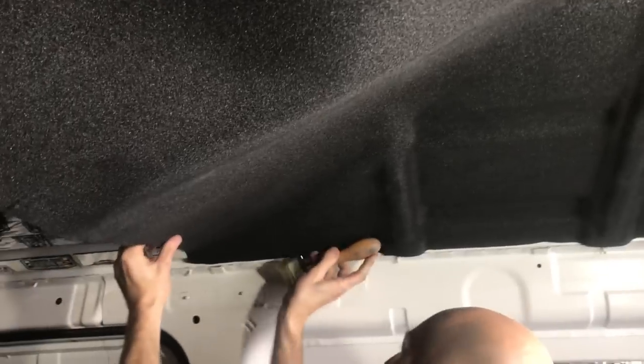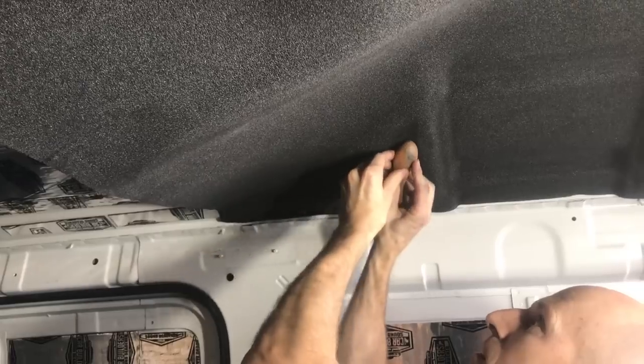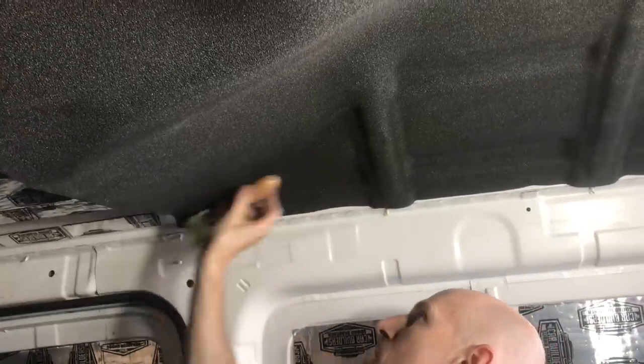So I'm going to push it in there first. And then that allows us to chase it down here. So you use both ends of this roller, especially where these negative shapes are. And you can see our plastic's sitting about there at the moment. Which makes it manageable. So it's probably running up here. So I'll start following this one up too. And you can see there it's pushing into that high. So our plastic's running, I can see the line there. So I'm gonna go back, peel a bit more of it, and then we'll keep chasing that up through.